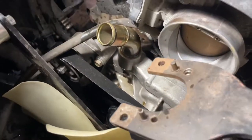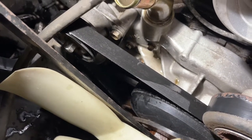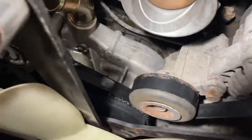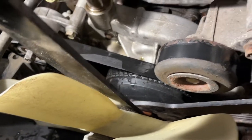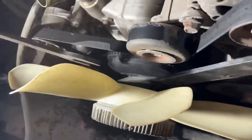See your spanner wrench right here — it's got these pegs that fit into the holes on the water pump. There are four holes on the water pump. Our problem is this one is just on there really tight. Repositioning and trying again... cracked it free — cracked my elbow too. Once it cracks free, it comes off like butter. That big rusty nut-looking thing — yeah, she's good.